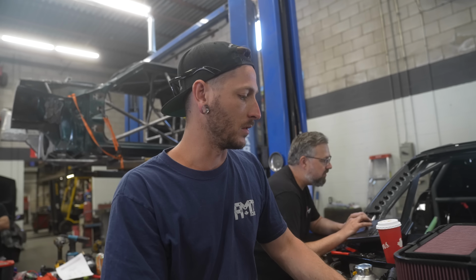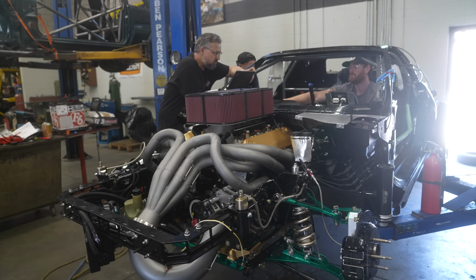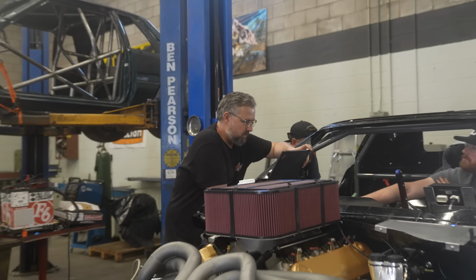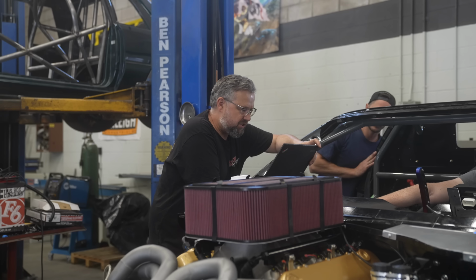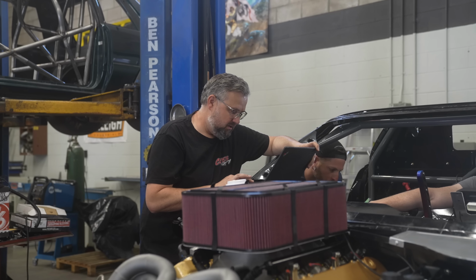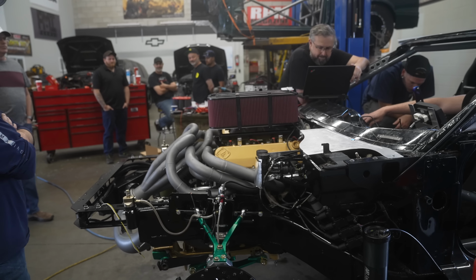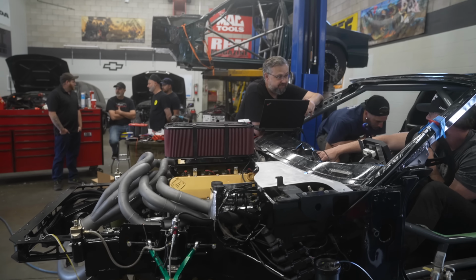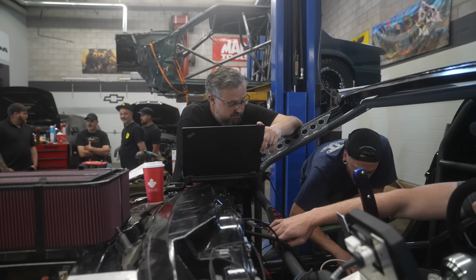We've got 13 volts at the injectors. Okay, so it goes active. All the injectors go active, all the ignition goes active as soon as he pushes the start button. Yep. But the fuel pump doesn't turn on. But it says active here. Yeah, so this is activating it. It thinks it is, but that's not accepting the signal. So I think the problem is on your end.